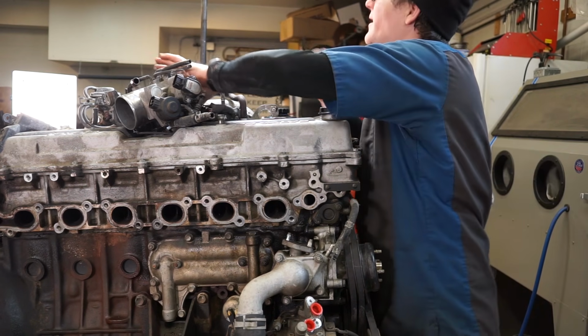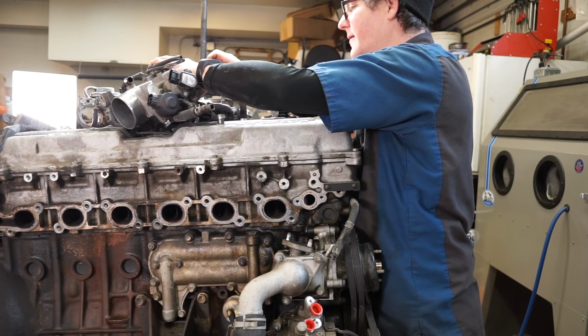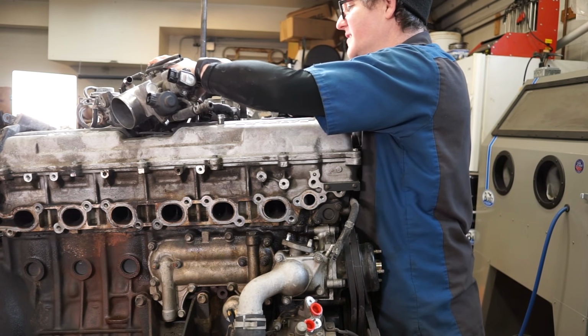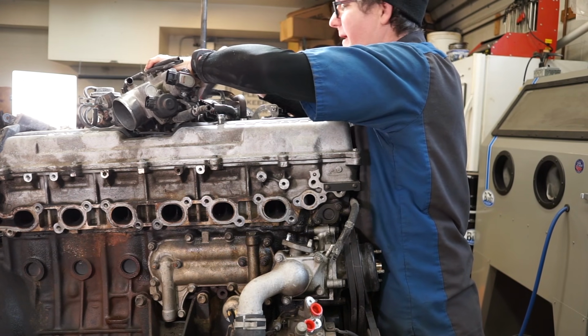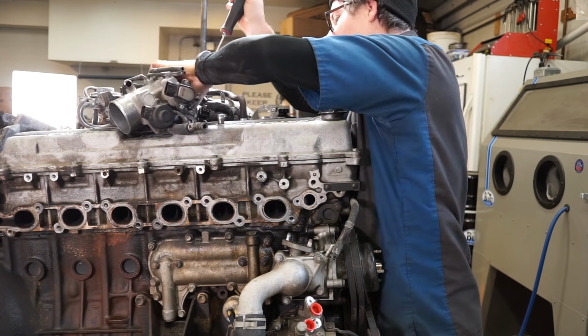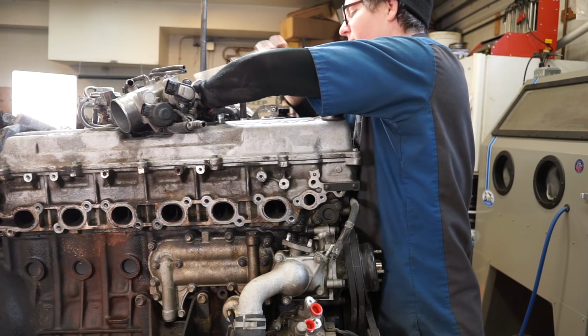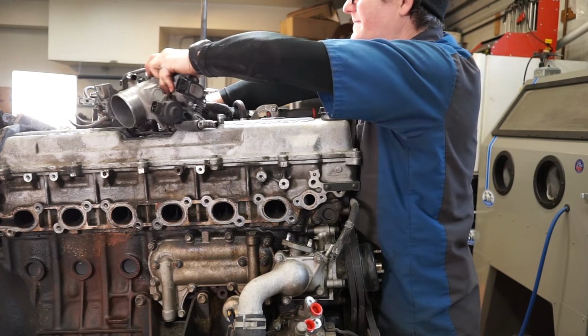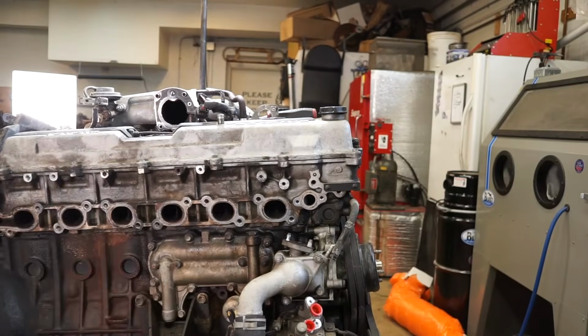And then normally this back hose would be another spring fitting, but somebody's put a hose clamp on this one in the past. So we're going to loosen that up. That guy out of our way. Now we can set the throttle body off to the side.